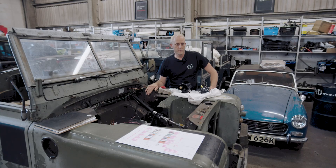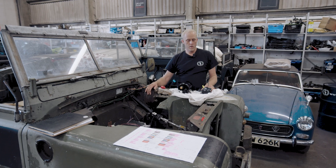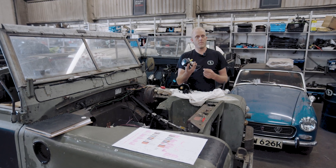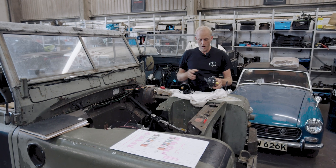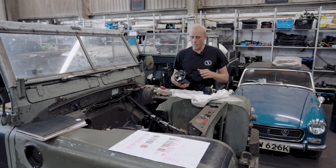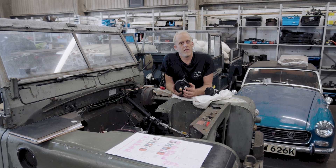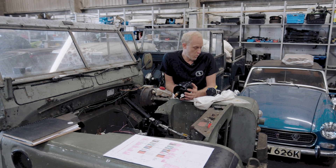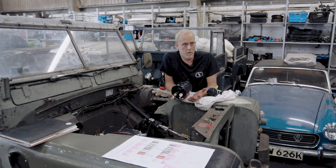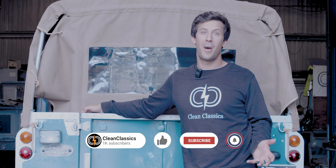As you can see, this left-hand drive vehicle is already equipped with servo-assisted brakes. For vehicles that are already servo-assisted, we fit a 12-volt vacuum pump — pretty common for EV conversions. But we also go a bit beyond that: we fit a reservoir with a vacuum sensor, and that's all wired in through the PDM. There's logic that controls when the pump kicks in and out, so you don't end up with the pump cavitating or burning itself out prematurely.